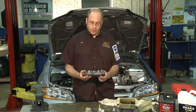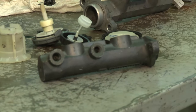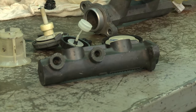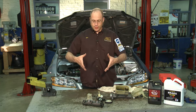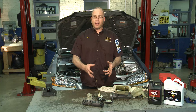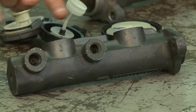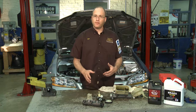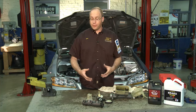This is a basic master cylinder completely stripped down all by itself. It looks like a metal flute or tube with a mounting bracket at the back. This back portion here is going to bolt to a large cylindrical device called a power booster — a big vacuum diaphragm, usually black, sometimes chrome or gold, located right behind the master cylinder. I have a couple of brake lines that come out from the master cylinder. There's a series of pistons, and that pressurized fluid when we step on it is going to hydraulically actuate the brake calipers or brake drums.